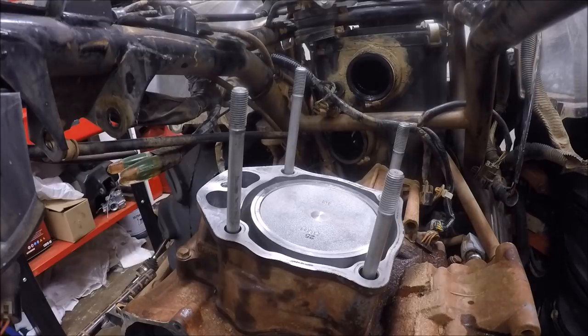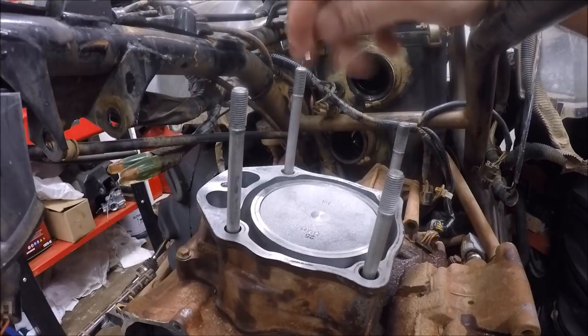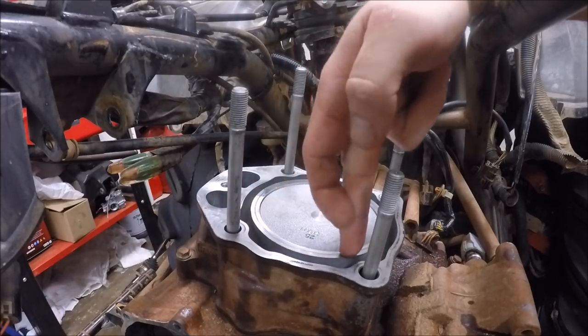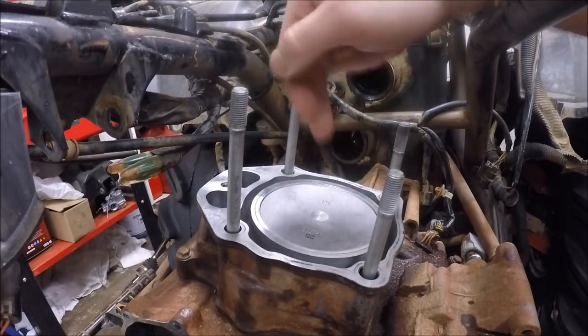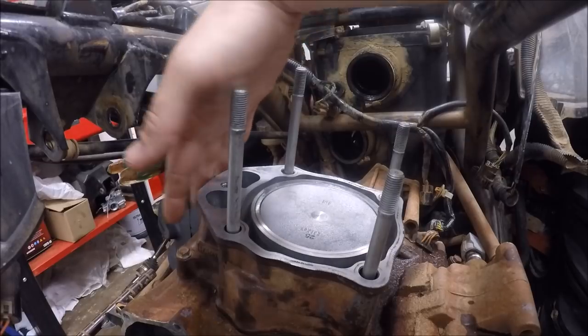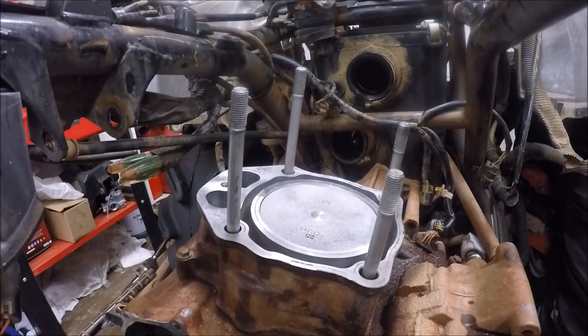I wish there was a simpler method — like the razors where you can put the piston in the cylinder with rings seated and just slide in the wrist pin outside the bike. But here you just compress the rings with your fingers, keep everything level, and sit down on there. My fingers are big so it takes a little bit, but everything is seated perfectly. Coat the cylinder with oil, then hand-thread the back two bolts and torque those down.